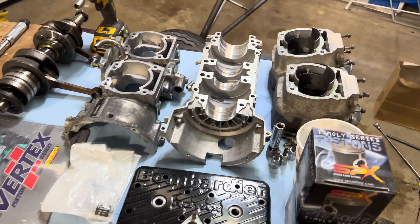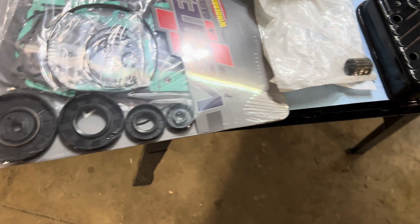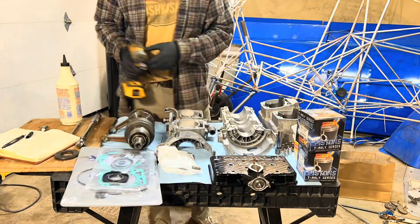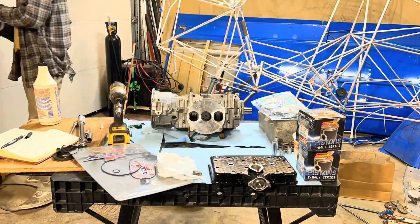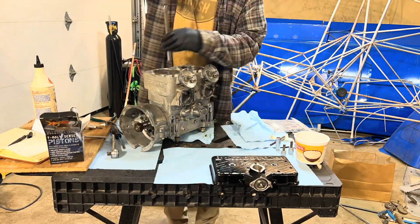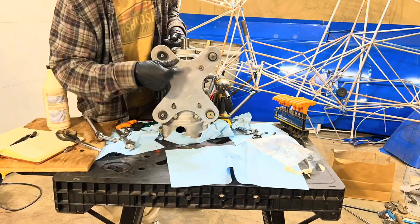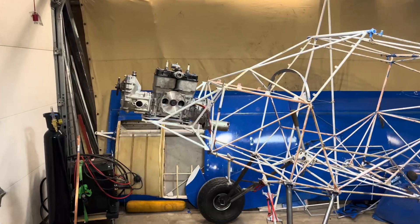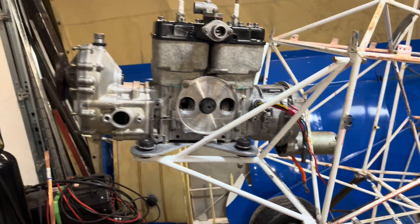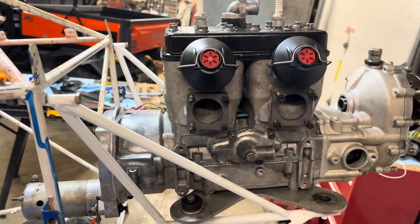Parts are in to rebuild this motor — everything's been sitting in cleaning solution. I got new pistons, a whole new seal kit, top and bottom end bearings, and anything else I need to rebuild this thing. Let's get it rebuilt and hopefully today we can get it thrown in the plane. The motor is freshly rebuilt and I just set it in place to see how it would look. It sits the same way the other motor did — there'll just be more features like all the liquid cooling stuff, but basically the same footprint with a lot more power.